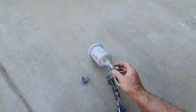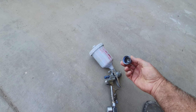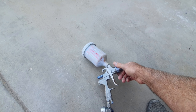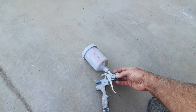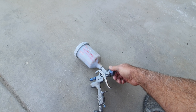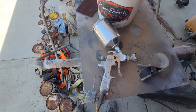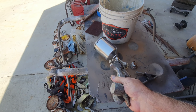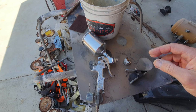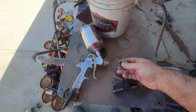The important thing when you look at a spray gun is the air cap fitting. This gun does not have a taper fit. On the other guns, there's a seal inside — a little white seal — that seals the air cap, and it has coarser threads. So if a little paint or clear coat gets stuck in there, you won't have much difficulty cleaning it out, unlike the cheaper Harbor Freight guns.